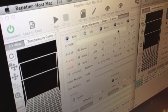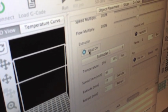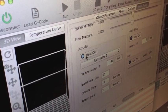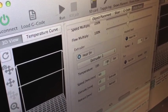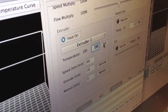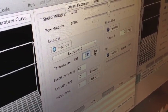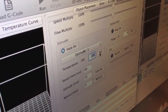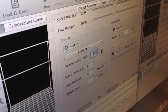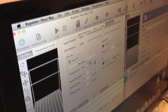Scroll down in this panel and go to your extruder. A dark light means it's off; a light blue light means heat is on. It's going to heat up to whatever temperature you set. I'm going to be using PLA today, so you'll need to fine tune your own PLA. If you get it from us, I recommend anywhere from 190 to 200 degrees Celsius.